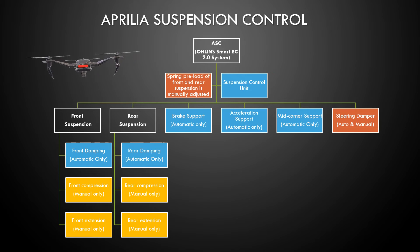So what this means is that if you're at a track day, you should find your favorite suspension guy — whether that's a Thermosman, Dave Moss, Turn 1, or anybody else you trust — and have them adjust the preload for your weight. And then the steering damper: if you are in automatic mode, the suspension control unit does adjust the steering damper.